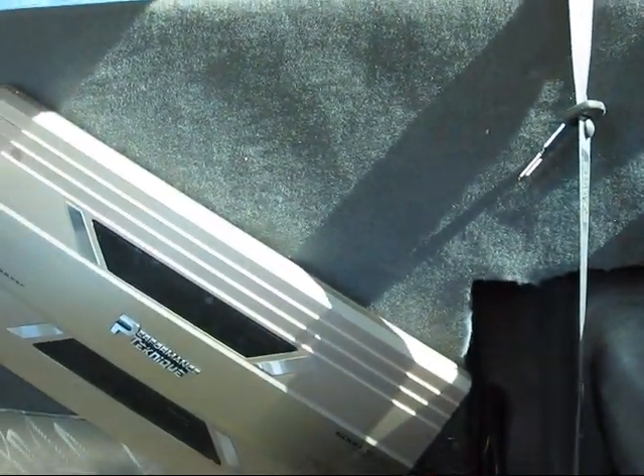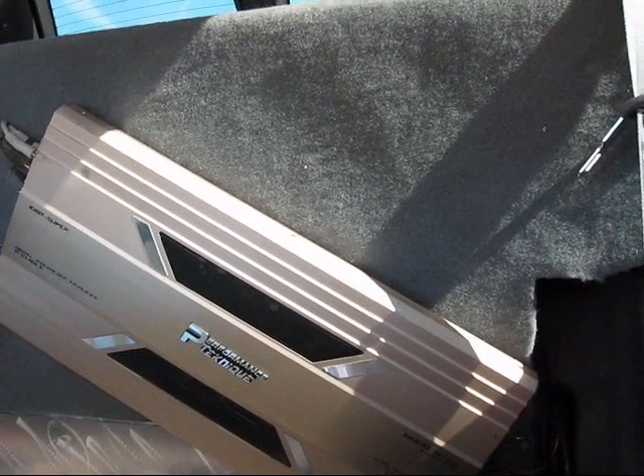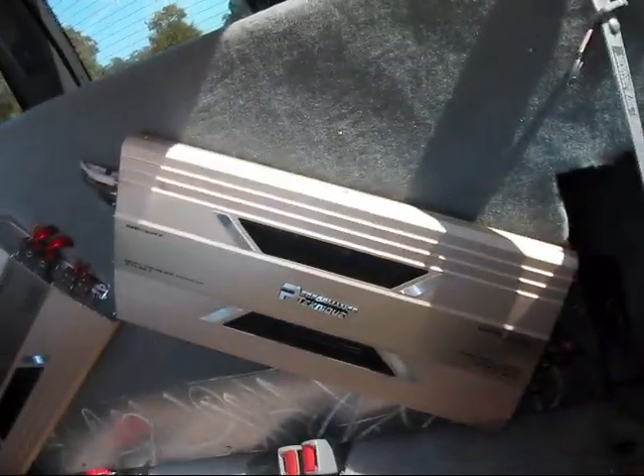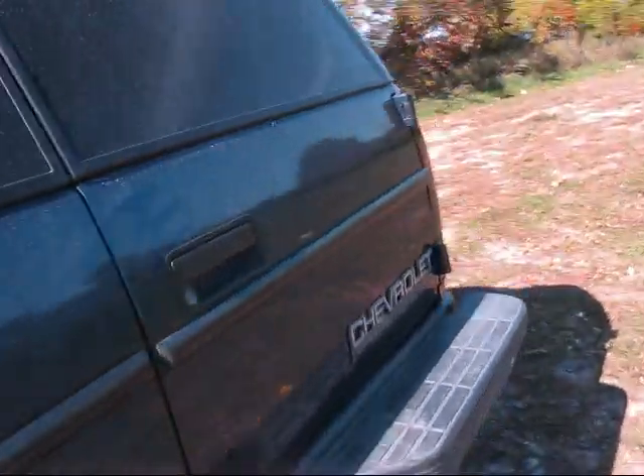There are the back two batteries. I went on darvex.com — D-A-R-V-E-X dot com — and that's where I got most of my wiring, most of my fuses and my splitters. I have a T-adapter inside of my box so that takes the one wire that runs back to this amplifier, and the wire that runs down the passenger side runs another amplifier and the one near the door on that side. You put the driver's side wire into the T and that splits it into two power wires.